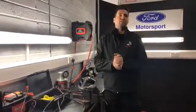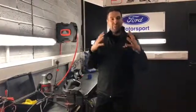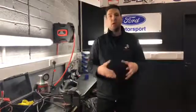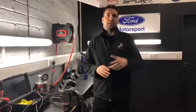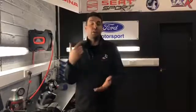What we say to you guys is, if you're getting work done, this isn't us saying you must come to see us, it's not at all. But irrespective of whether you want to get it tuned or get it quicker, or any work being done to your car, make sure the people you're using know what they're doing. Because this guy, our customer, unfortunately spent quite a bit of money and came here, and we knew after running it on the dyno that there was a boost problem. Instantaneously we said, right, let's get the Smoke Pro out and check for boost leaks.